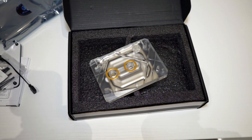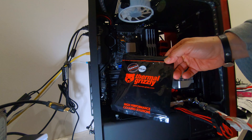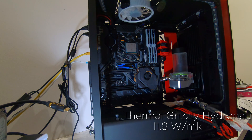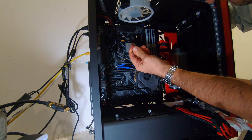Now follow me and let's install it. The first thing to do is to drain our loop and remove the old CPU water block, plus the motherboard backplate and the hooks near the socket. Then we apply our thermal paste on the CPU. I'll use Thermal Grizzly Hydronaut, which has a great thermal conductivity value of 11.8 watts per meter Kelvin — one of the absolute best you can purchase. There are a lot of techniques for applying thermal paste: a line, a big X, a star, or spreading it all over the CPU.